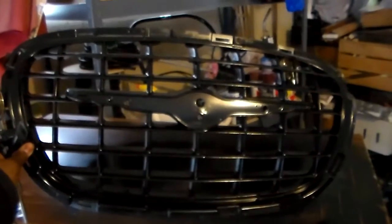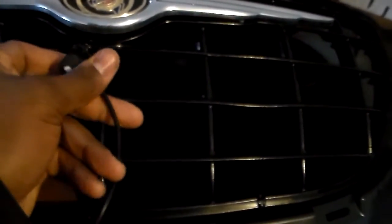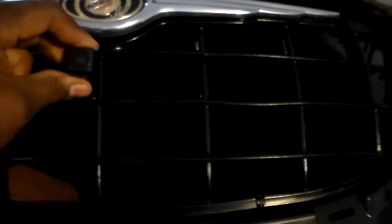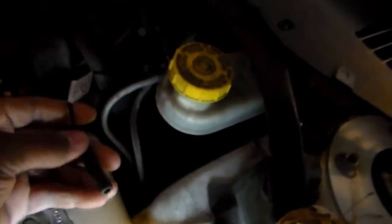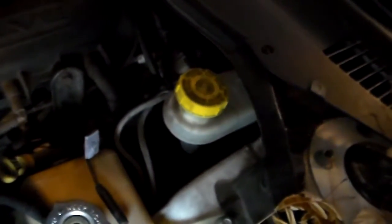It's the next day. You see how this grille looks — nice, right? The camera is going to be mounted right where this middle slot is; I'm going to cut part of this middle slot out and mount it right there in the middle. The initial cable right here is about four feet long, and it plugs into this one here, which I've already run under the hood and from inside the vehicle. I just need to pull the head unit out and make my connections in the back of the radio, then put the chrome bezel back in, put the grille in, wire everything up, and secure everything.